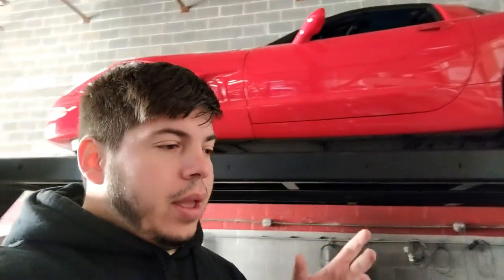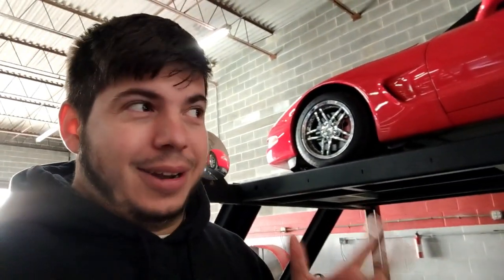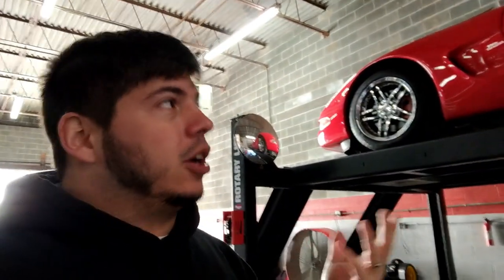We're not really making the power that I'm expecting out of this thing, and then we blew a coupler off and we called it quits. I think we got a couple other things that need to be fixed. The converter just blows right through it, but I did lock it up and it didn't blow through it then, so it could just be way oversized for the application.